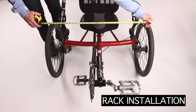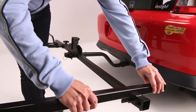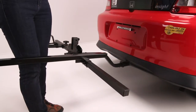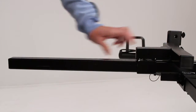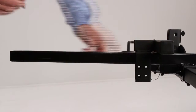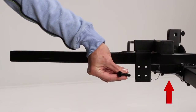Now, measure the track and wheelbase of the bike. Slide the long connector tube onto the rack's right-side wheel tube. If your rack is the HR1000R or HR1450R recumbent versions, slide the universal connector or install the bracket version on the long connector as shown. The lower holes on the bracket are used to clear the welded gusset on the long connector.